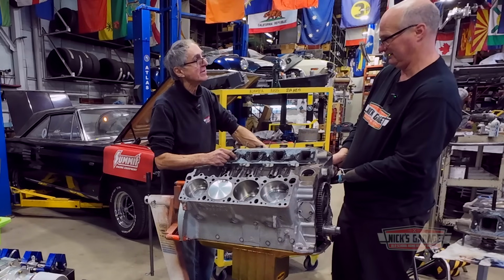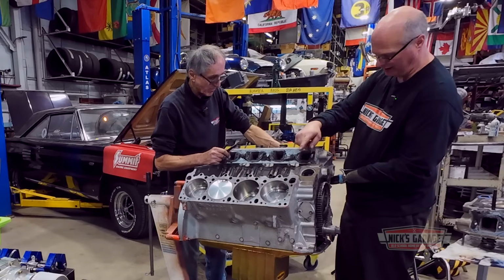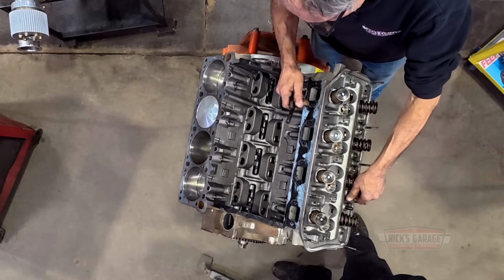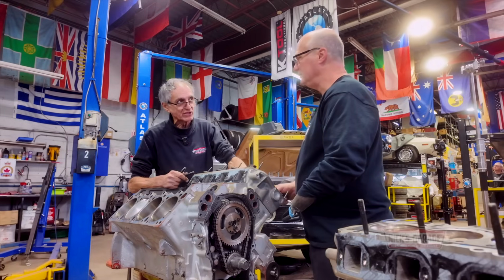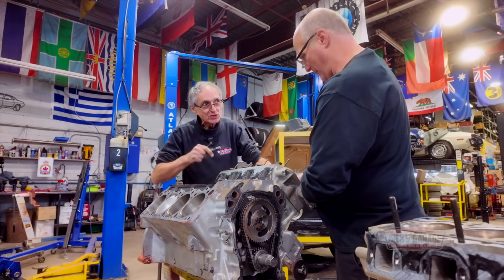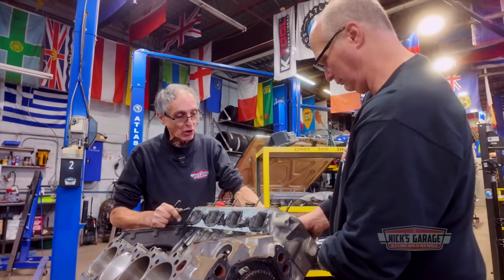And the intake too. The intake will come straight out. I noticed you don't like a lot of silicone. There's silicone everywhere in that thing. Well, no, they didn't put it like everybody. But see this gasket here? You're going to spend a lot of time trying to remove it off the cylinder, but they glued it all across. Like I said, I only put a few tabs just to hold the gasket in place so it doesn't move while you're putting the intake manifold on.